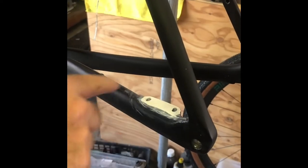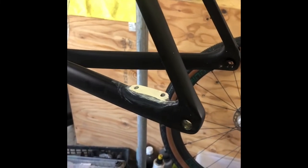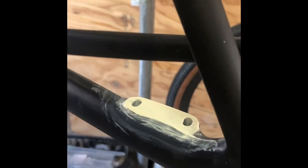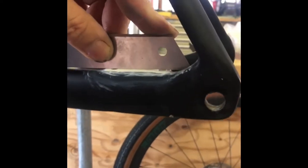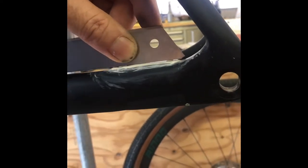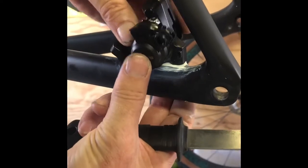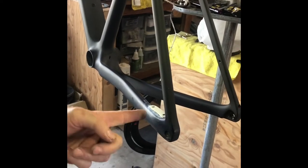This is the rear — I've sprayed some paint on it. It's exactly the same frame, a GV 33. This is called the pedestal, the rear pedestal. If we look at the caliper it should be flat all the way across the holes — it is completely flat — but because of the paint it's going to be lumpy, so when we tighten it down it might have an angle and we don't want that. This is a really simple, easy way to get a perfect 90-degree alignment on your rear pedestal.